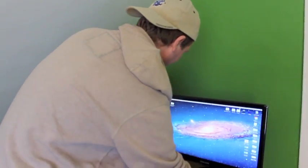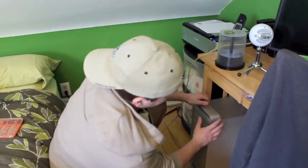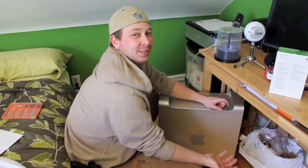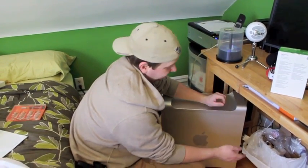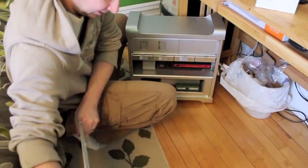First you want to shut off your computer. Once you have it shut off, you can proceed to slide it out. I would recommend removing the power cable from your Mac Pro just in case. Flip the switch back here — that slides out.